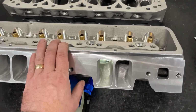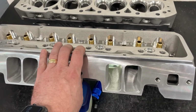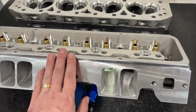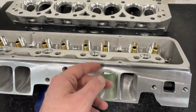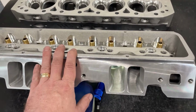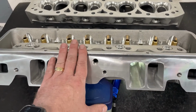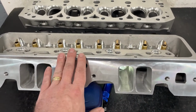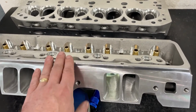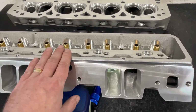Now, I have several versions, of course, that do require shaft rockers, but shaft rockers typically run about $1,500 to $1,600 for the ones that you need for this. You can't use the Sportsman ones when I move the push rod slot over. They don't offer enough offset for that. So you have to get the more expensive shaft rockers for my offset versions. This one doesn't require it. Stud mounts work perfect. So I've got a similar version of this called my 242, which takes stud mount rockers, but it's standard valve spacing. This one's better than it. So just letting you know.